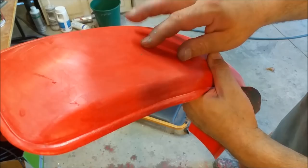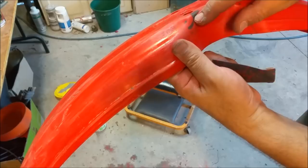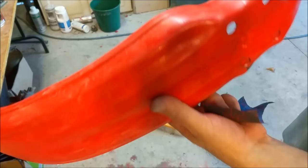So got to finish underneath. This only had the one crack, which finished there, and I've drilled that crack out, and I've valleyed it with a knife. It's just plastic, so it's fairly soft. Filled up with filler. Just got to finish that bit there, but given that's behind the forks, I don't reckon it matters anyway. So that, followed by the side guard, we've got to do a bit more work finessing some of the filler there. That flexi filler sands beautifully, and then we're ready to paint this.